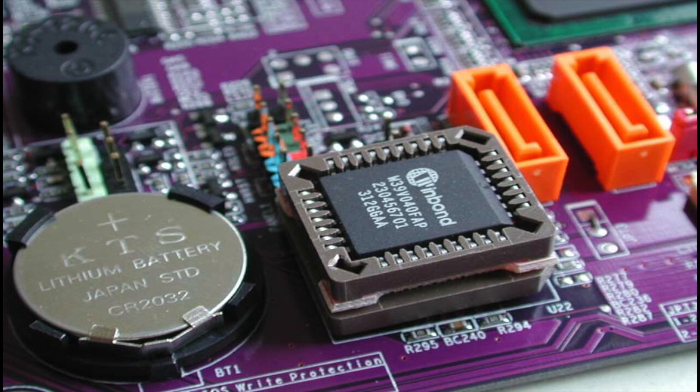I'll quickly explain the actual boot-up process. What it actually does is it checks the CMOS battery for the date, time, etc. Then it loads the drivers for all of it. These are hardware-specific drivers, needed for the device to be recognized by the motherboard itself. Then it starts the power-up, does the POST, and displays all the system information — that's the white text on the background. Then it checks what devices are bootable — say you have a USB hard drive, it checks if that USB is bootable. Then it actually initiates the bootstrap process and boots up the OS.